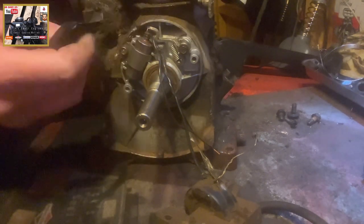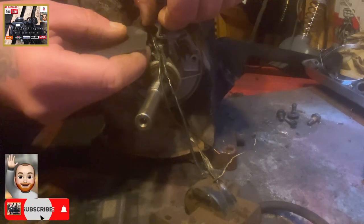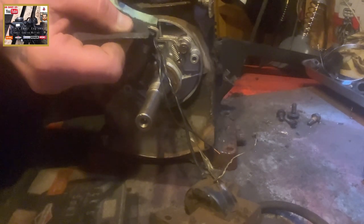All you want to do is fold the sandpaper in half, so we're getting both points on the condenser as we're cleaning. Lift your points — obviously the points are closed so we're going to have to lift them — and then work the sandpaper back and forth, approximately 30 seconds to a minute.